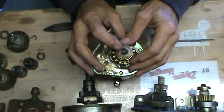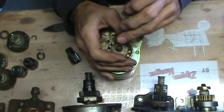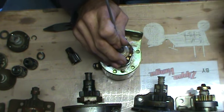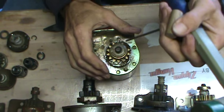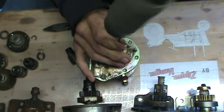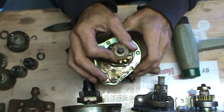That seats the snap ring on just one little side. And then, the reason for my little groove in the screwdriver — you take it and, as you can see, just two little taps and I've got it around. Another tap here, and that ring is right back in place. You're golden and you're ready to rock and roll.